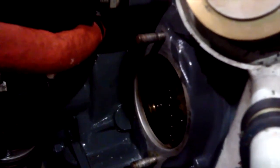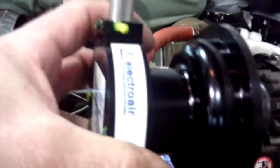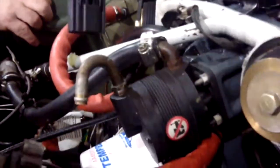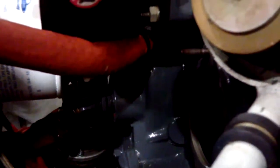We're in process. As you can see, there's a big gaping hole on the back of the engine — that's where the right mag used to be. We're getting ready to put the mag timing head in, and it's been timed. We've taken a gear off of a right mag and cotter pinned it onto the gear. The engine is at zero degrees top dead center — not 25 before, but actually on zero — and that's why the pin is in the back of the timing head, so that we put this thing in at zero degrees. The electronic ignition controller figures out where we are in the rotation process from there.